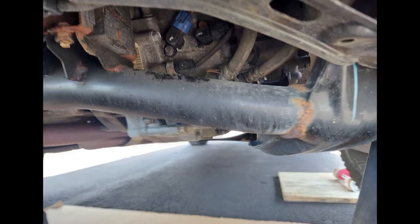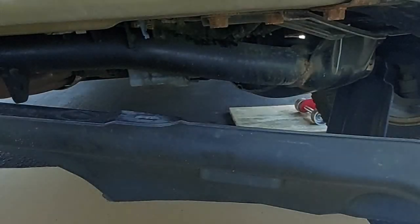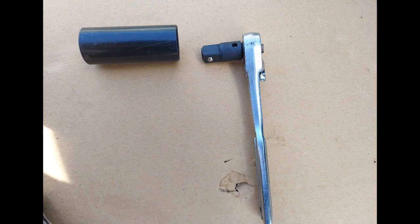For the oil sender switch, you go to the front of the car and underneath. I'm going to zoom in to show you exactly where it is. To get to this location, I started by turning my wheel fully to the left, which allowed me access to the plastic push pins that hold this plastic guard up. You remove this guard — there are two spots, one here and one to the right. Once that drops down and is out of the way, you'll be able to pull the wire harness off the switch, get your wrench on it, and switch to the new one. It's definitely the easier of the two, so I would start with this one.